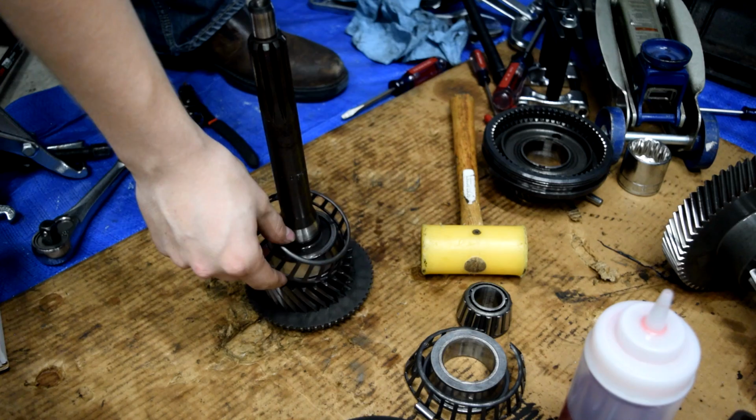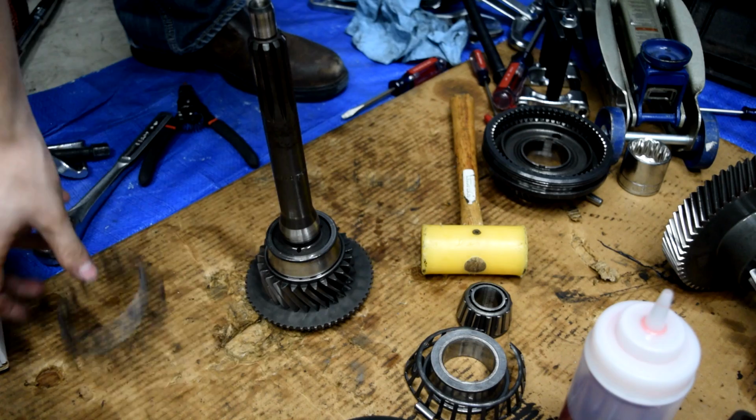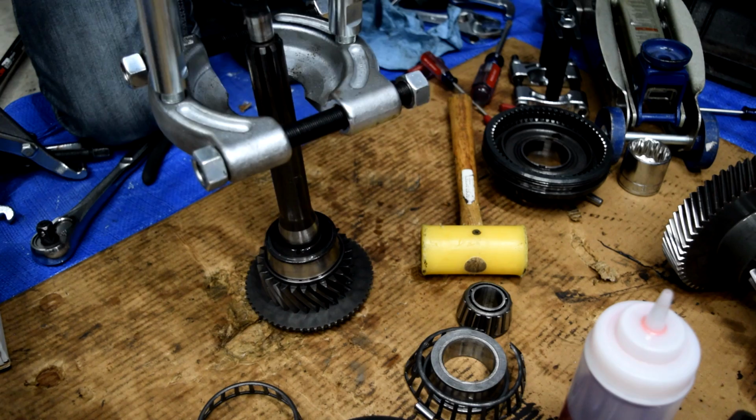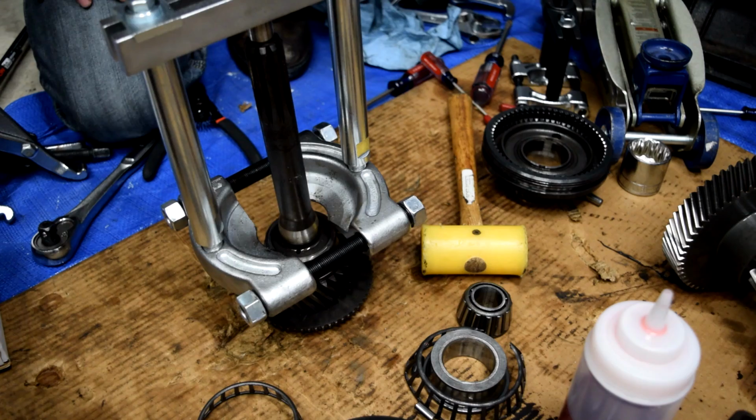Main shaft, we've already cut the bearing off of, as you've seen this procedure done. This input shaft, we've already cut the race off of this bearing, as you've seen the procedure earlier in this video. So we'll go ahead and remove that, and then what we are going to do, bearing separator. This is one of our rental tools, one of our many rental tools. No, doesn't reach. Further jerry-rigging,